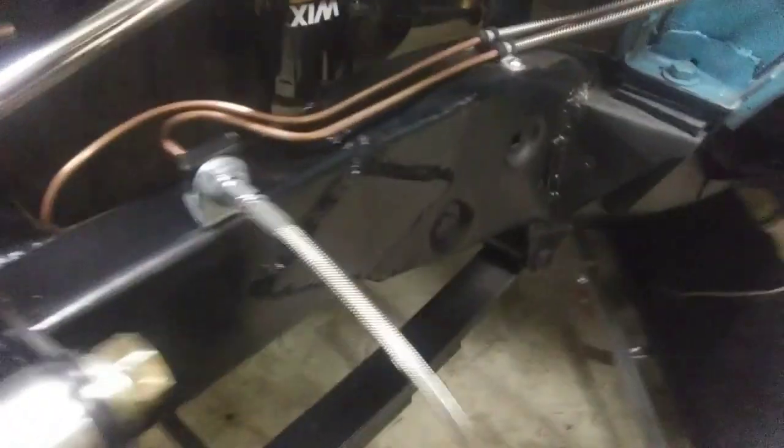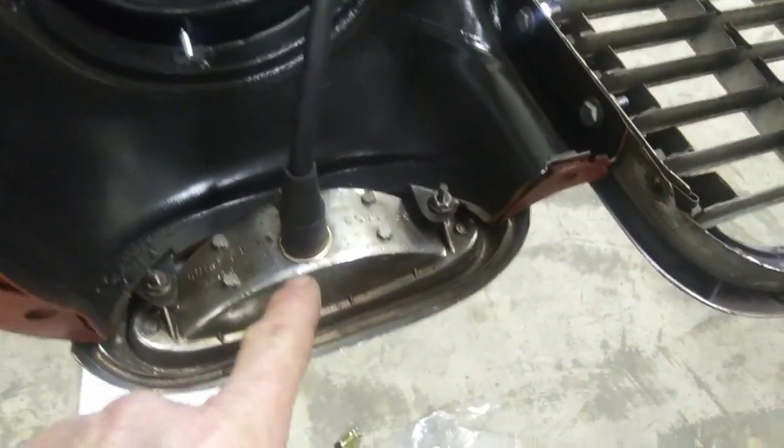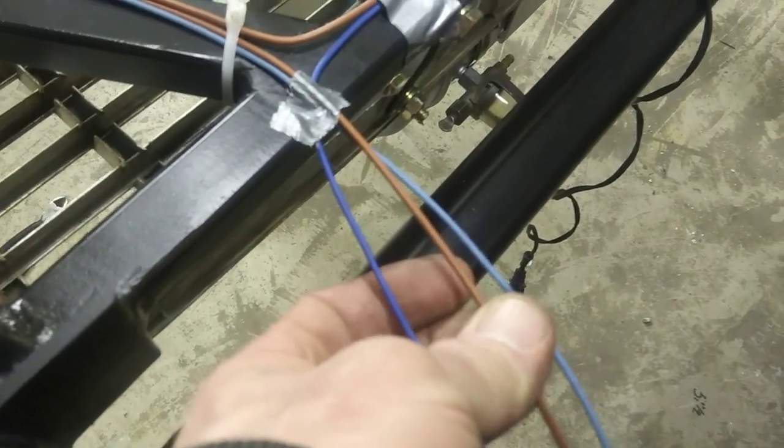I've been lacing these front headlight wires. They're gonna come out of a grommet hole and then go back behind there. There's a little clamp and I'm gonna run them on the inside of the frame, clamp them nice, tape them up, then they'll go right underneath the steering box - through that little space between the frame and the steering box. I did get the one marker light parking light hooked up. Had to make an inline splice here - there's a left and a right, and then the brown loops off on one side and goes over to the other side.